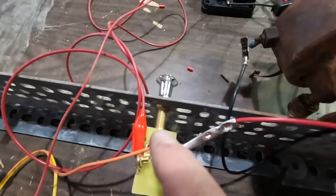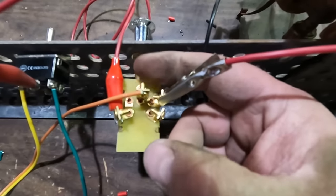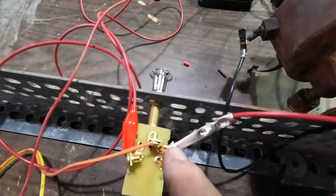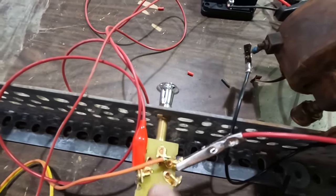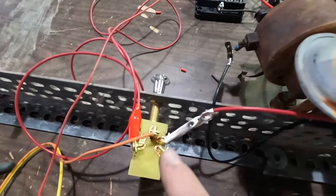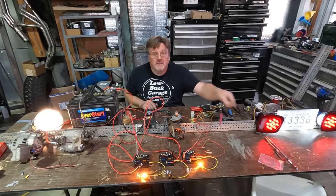I'm thinking I want to run headlights off the accessory power — that way when I turn it off the headlights go off for sure. If I want headlights on without the engine running, I can turn it to accessory. But now we have to run through a switch. For this truck I'm going to run through a two-position switch, much like a factory one. Power in, pull out one position and that turns on running lights for taillights and marker lights. Pull out two positions and headlights turn on too. We pull out once — running lights. Pull out again — running lights and headlights.